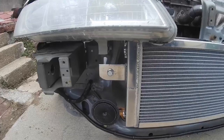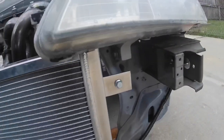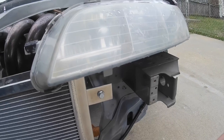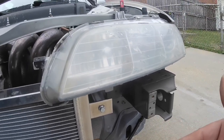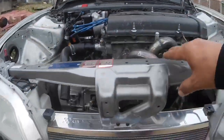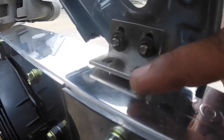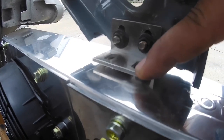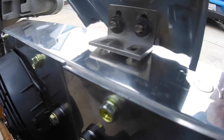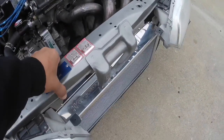I ended up getting the radiator mounted on both sides — just a bolt, a washer, and on the back two rubber washers against the core support, then two more rubber washers, another washer, and the bolt. It was still super wobbly so I drilled two holes and added a piece of aluminum angle. When it gets a little warmer I'm going to try to aluminum-braze this, but it's too cold for the metal to heat up properly, so I might just take it somewhere and have them run a bead across to get it more supported.